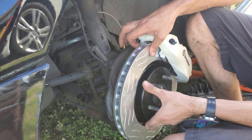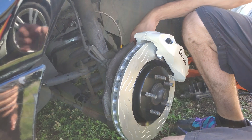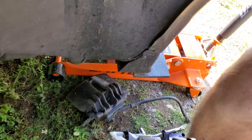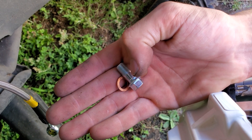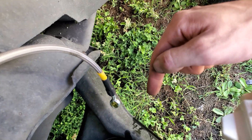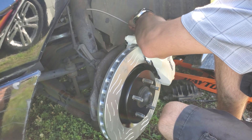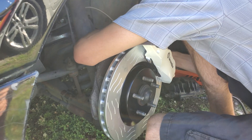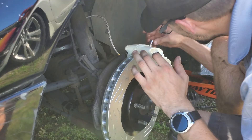I don't know if there's a torque spec for all this stuff, but I would just make sure that you have it tight. Behind the caliper there's this bracket which we didn't take off because we painted it. We pull it off and then we have this little guy — it has two holes. So we put one spacer on the screw, then go through the bracket, put the spacer on the other side, and then screw it into the caliper. Then there's a sticker on the brake line we have to remove. Put the other spacer around it and screw it into the caliper — that's a 12mm. Screw that one tight.